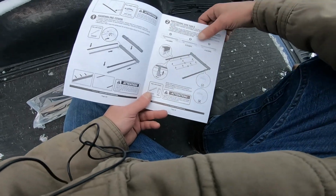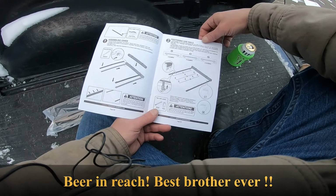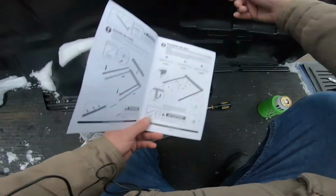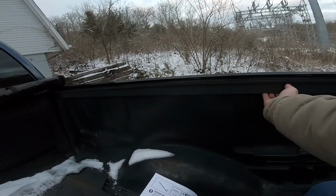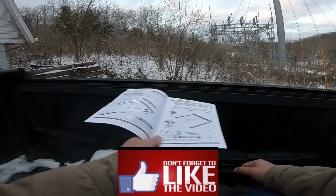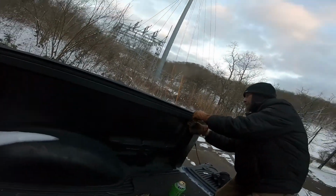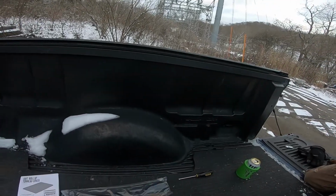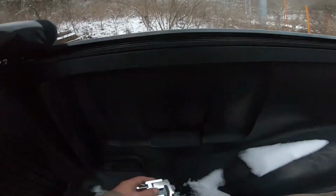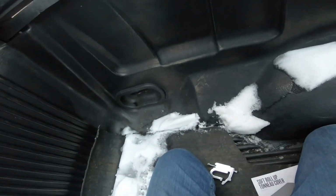Alright, position the side rails and the clamps. Oh, now we're just going to install the clamps. So they should fit right up underneath this ledge, like a truck cap. Yep, just like a truck cap. So we'll do one in the front, one in the back, and then one in the middle. So hand me a couple of them. It doesn't have to be exact. I'm sure they'll tell you don't tighten them down yet because we'll need to adjust it back and forth. Okay?